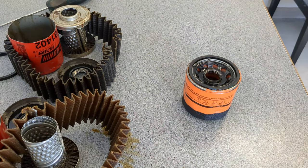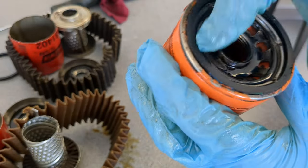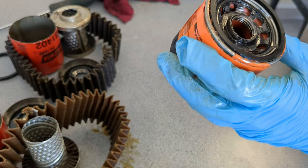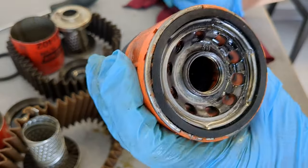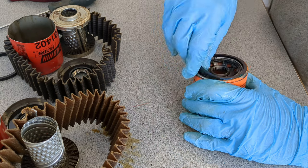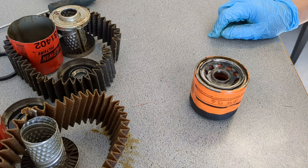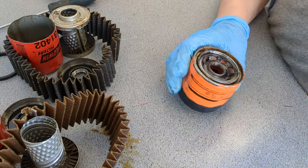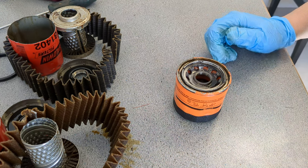And now to the star of this video. Do you see this? This is sludge. All of this is sludge inside this filter — it's horrible. I'm gonna wipe off some of it to show you. That black sludge is terrible stuff. That's probably why the oil that came out was coming out so slow and seemed to have a consistency more molasses-y — more thick than it should have been, even for conventional oil. So I'm gonna cut her open and we'll get a look inside this one.